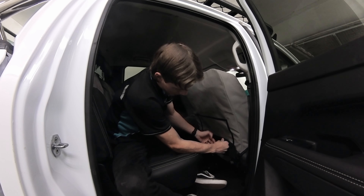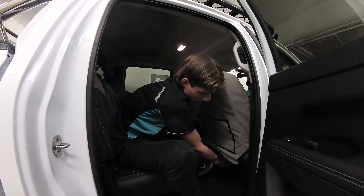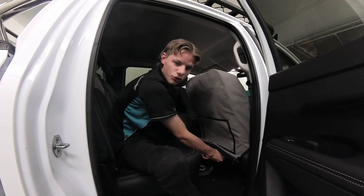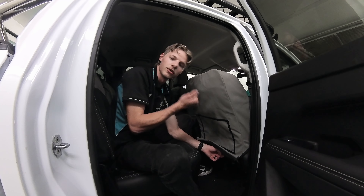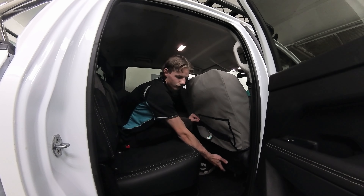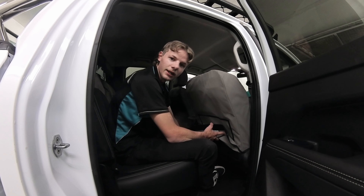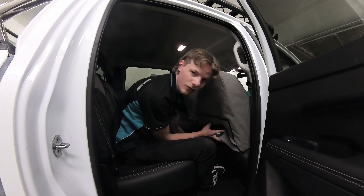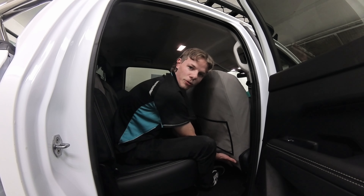From the back, lift the carpet tab again and feel for that back piece. Pull the flap with the hooks nice and tight and make sure it's straight. Then grab those two hooks and hook them underneath onto one of the metal railings where there's a bit of tension to pull the front nice and tight. Once done, reattach the carpet flap. Grab the side piece between the seat and console, pull it nice and tight and wrap it straight over the carpet. Then pull the back piece straight over top of that — that's why it has the double-sided velcro.